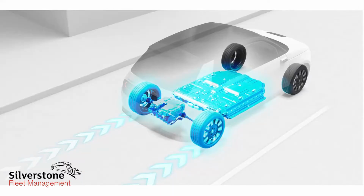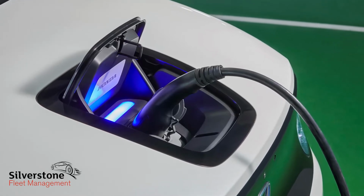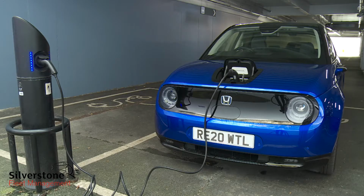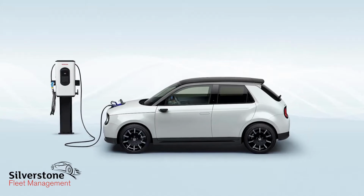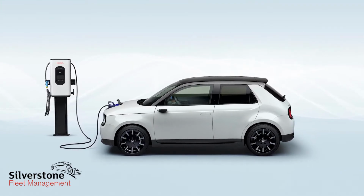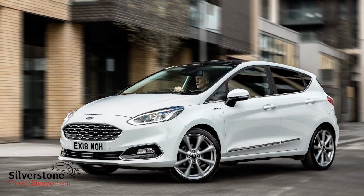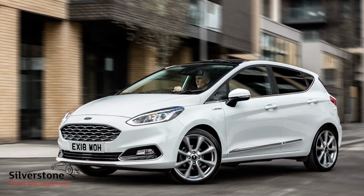And the battery's tiny size means it's quick to charge too. Think 4.1 hours from a 6.6 kilowatt home or public AC charger, or just 31 minutes for 80% replenishment from a CCS2 50 kilowatt DC fast charger. With a typical electricity tariff, you'd be paying around 4p per mile to run this electric model. That's around 2.5 to 6 times cheaper than an equivalent car with a petrol or diesel engine. Lots to like then.